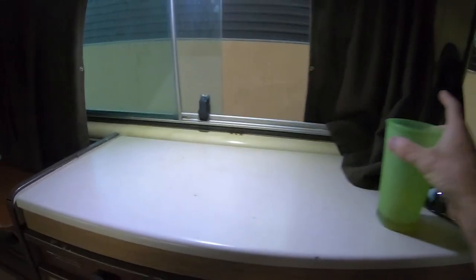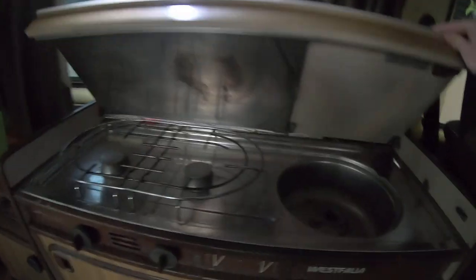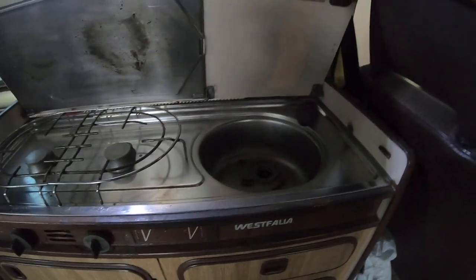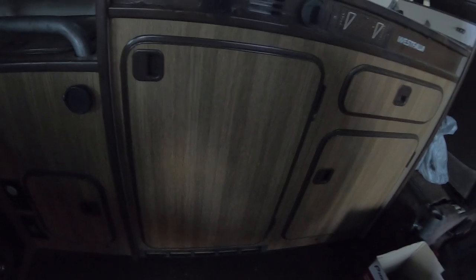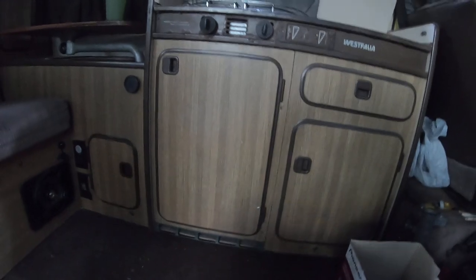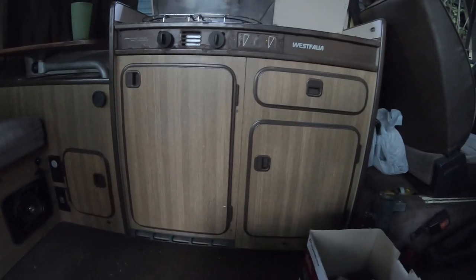There's actually a cook stove under here too. The camper van has a built-in stove — I just set one up outside — a sink, and a fridge. The fridge doesn't work right now, I've got to get it working or replace it. What's cool about these fridges is they run on 12-volt, 110, or propane. The propane is really the best because you don't have to run your engine, you don't use any power, and you can be off-grid for days — your propane lasts forever in a fridge environment.